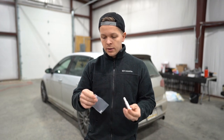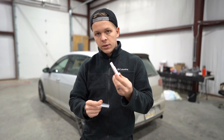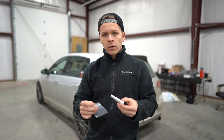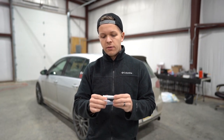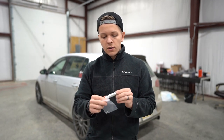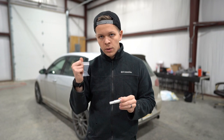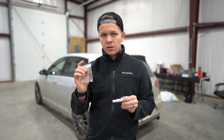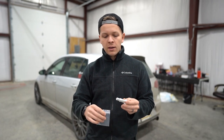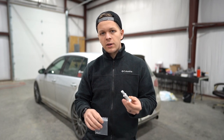You get the super pin, a sticker, a screw, and a couple of washers. What this is going to do is replace a plastic pin that's in there — the tolerances on the stock one are not very tight. This is going to get rid of a lot of the wiggle and shake in the shifter and hopefully give us a little bit more notchiness and tightness. We need to rip apart the center console, which is going to be the hardest part and take the most time.